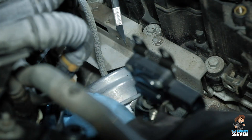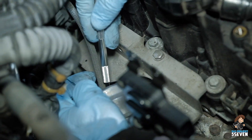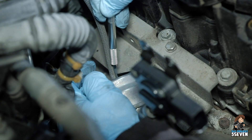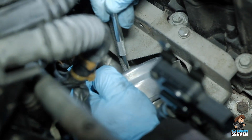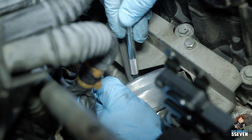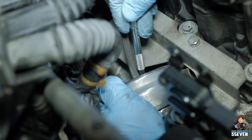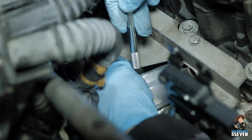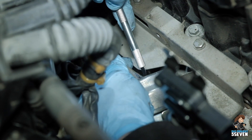We want to extract the compressor bypass switchover valve, and for that we need a screwdriver. It's clipped onto this board - there's a clip - and it was easy. This one is the turbo switchover vacuum actuator. It has a hose and it comes from the pressure converter on the bracket. In order to remove it, don't pull on this because it's a metal nipple - they do break. If they break you have to replace the whole actuator, or you can epoxy some kind of nipple on it, but the new one is about $200. So just gently cut along, and eventually it will separate. The factory ones are seated quite deep so you can't see it, but you can sometimes go in from the other way and cut it that way.